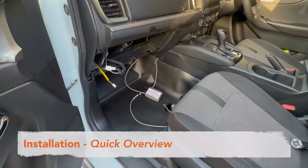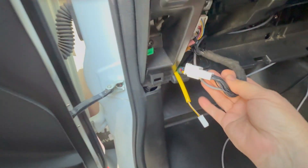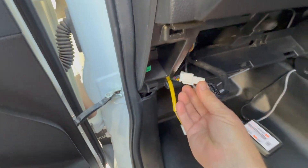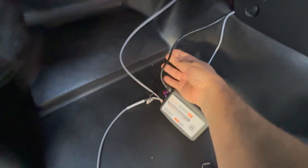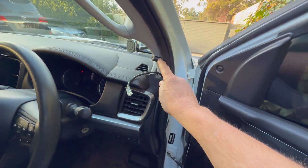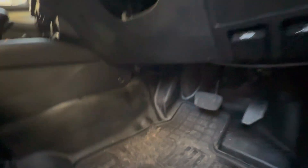Here's a really quick overview of what we're going to do. You've got the lock-up kit controller, the plug-and-play cable that goes to the transmission computer. You take away the glove box and the trim to get access to it — just plugs in. You've got a load resistor to place somewhere, a cable to the OBD2 connector, and a cable to the LED switch. Coming around to the driver's side, you've got the LED switch which you mount onto the trim, and the OBD2 connector which just plugs in. It can be easily removed and done without leaving a trace.